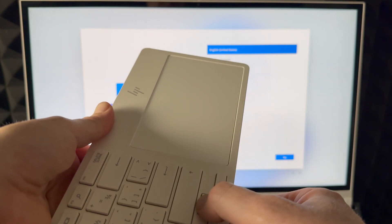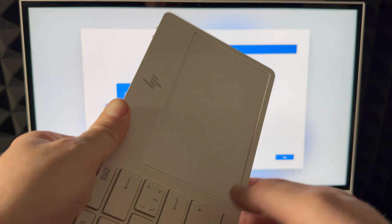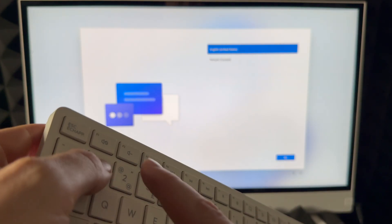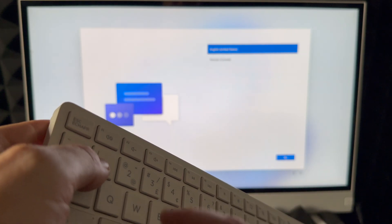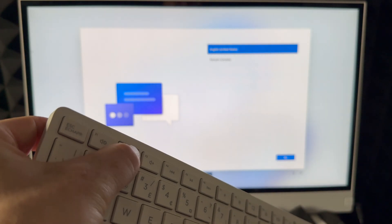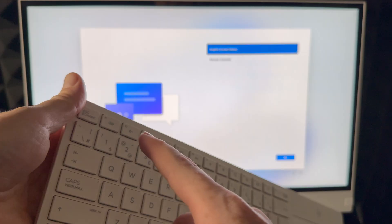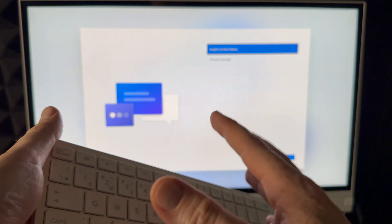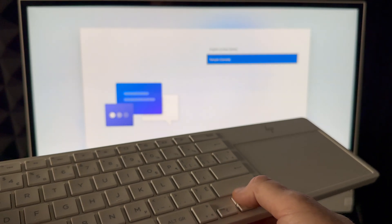Test the keyboard by pressing up and down arrows. To really confirm it's synced, press the volume keys — if you see a volume indicator come up on screen, that means it's synced and you're good to go. It should sync automatically. Make sure it's close to the computer, and then your arrow keys and trackpad should work.